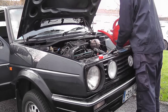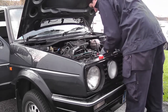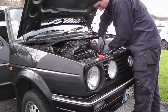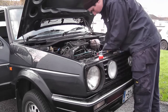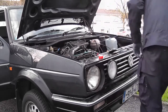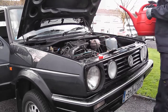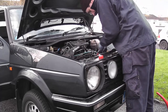Okay. You're gurgling. Okay, so there's the water spilling out the top now of the head, so what I'm going to do is pop that hose back on. Okay, so that's that done. So now we have a completely closed system. I'll put this super annoying clip back on. This one should walk on, hopefully. The next step after this is to run the engine, try and remove any airlocks or any bubbles, and get it up to operating temperature.